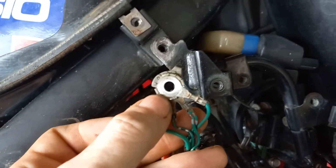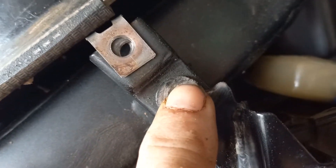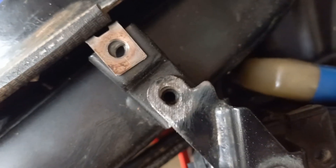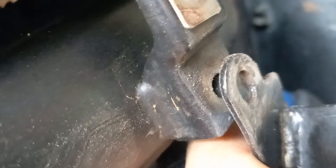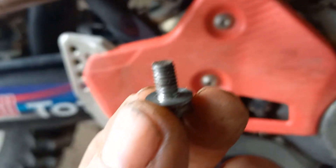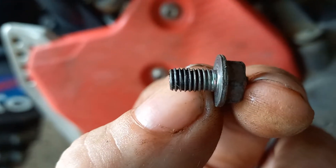You've got a bunch of earths there that are really corroded, and if you look at the connection on the frame — which I've already sanded — you can see it's really badly corroded and eaten in bits. So that's not really making a good contact despite me sanding it off already. But what's more important is what goes on around the back there, because that's all got to make contact right the way through. You might assume you'd be getting enough contact through there and through the threads.